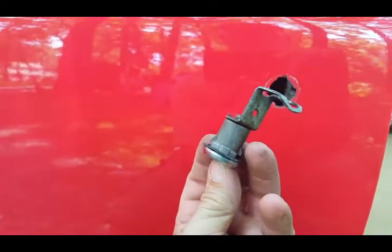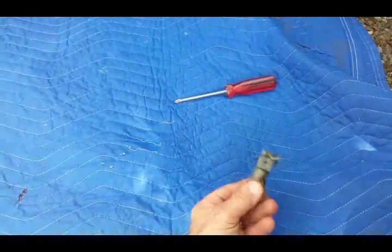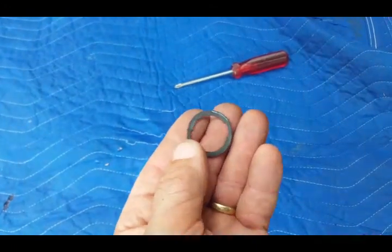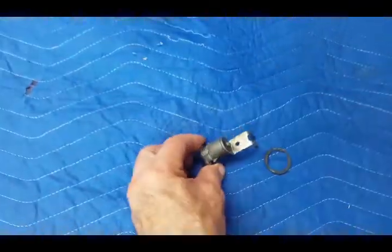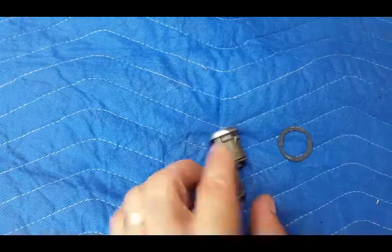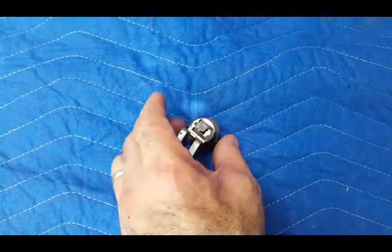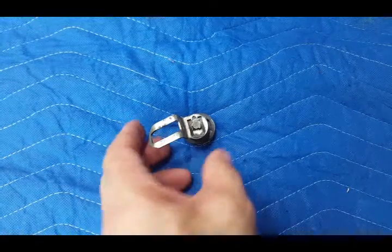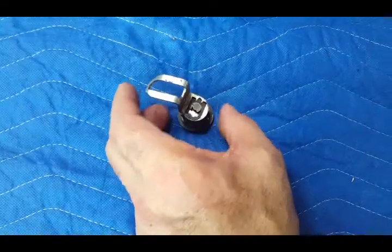The lock is done and it works. Now this rubber gasket has a little ring indentation on both sides — it sits right on the lock where those raised parts are on both sides. When you install it, make sure this piece sits right where those indentations are on your rubber gasket so it doesn't squash the gasket and it's easier to install the clip.